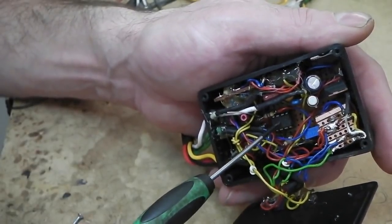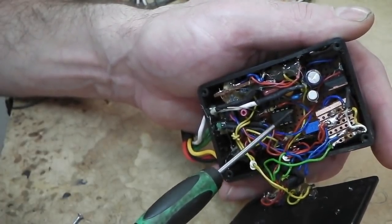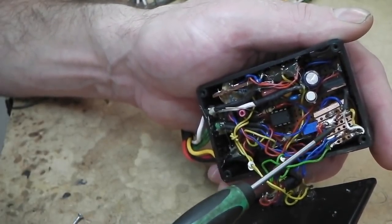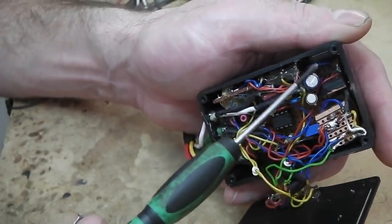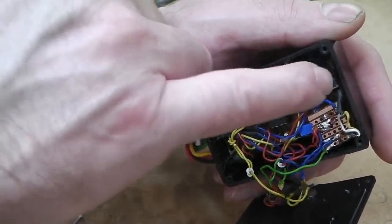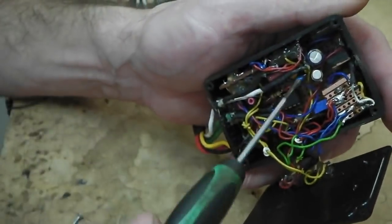You can drive straight off the chip, but the way that I've done it, there's an intermediate stage. The output of the chip is coming into a capacitor, charging it. The transistor measures that, flips across when the gate value goes, fires the safety relay, which then fires a 20 second delay. Just there's a regulator. I've had to chop the top off the mounting tab of the reg. Normally they have a little metal mounting tag, but it's not under heavy loading. It's a 9 volt reg. I've gone for 9 volts for the whole system.